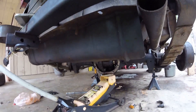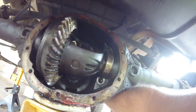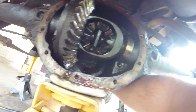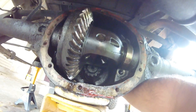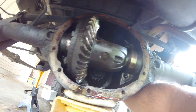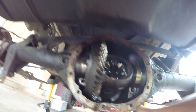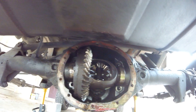So I tore it apart. That's actually the pinion gear here — I don't know if y'all can see it — but I've got some teeth missing, and whenever it gets to the teeth where the teeth hit the ring gear, there's play in it. So anyway, that's my project. I'm gonna replace the pinion gear and the ring gear.